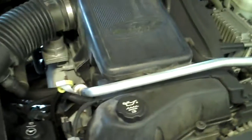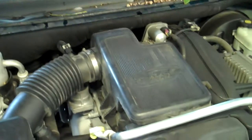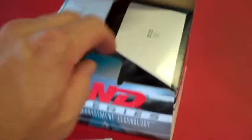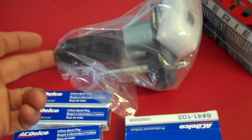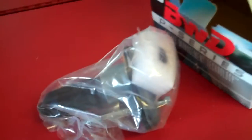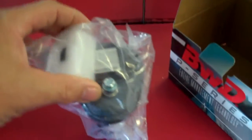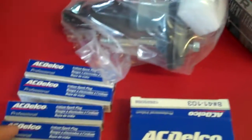When we scanned it, number four coil pack is not working. The coil pack goes right on top of the spark plug — this is what fires that plug. Instead of having one coil for the whole car like older cars, you have individual coil packs right on top of each plug.